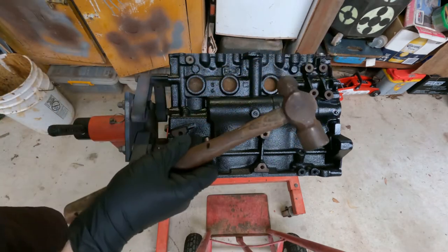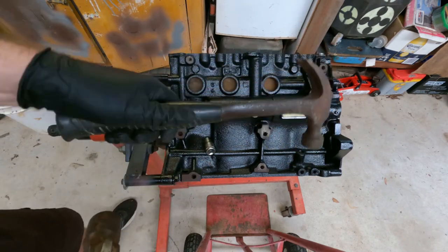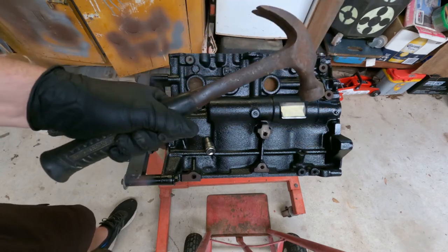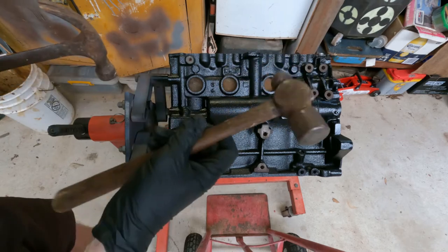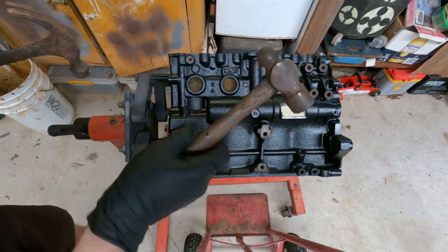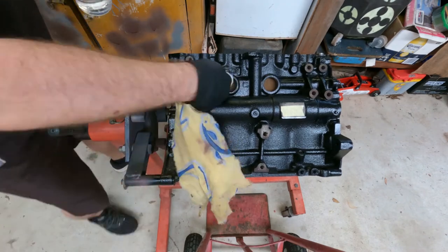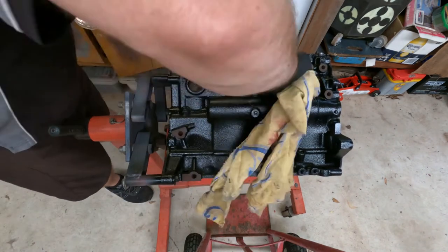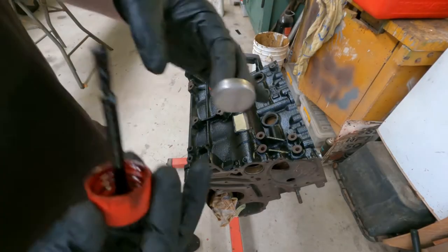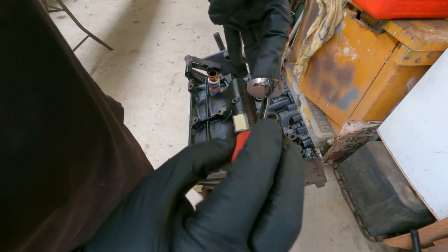For choice of hammer, I'm going to use a ball peen hammer, nice and balanced, a nice controlled hit. You can use an ordinary builder's hammer, but these are basically designed for thrashing in nails, so they're hard to have a really controlled strike, whereas the ball peen hammer's got a nice weight at the end. You can choke the hammer very easily and change the pressure of hitting. To make sure all the insides are very clean before applying the gasket material. And of course, make sure there's a good covering of gasket material all the way around the outside of the Welsh plug.